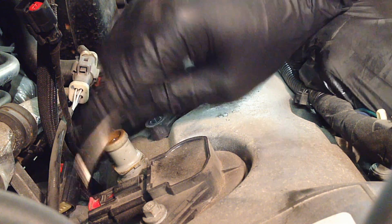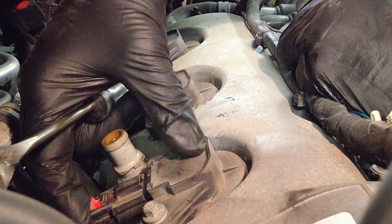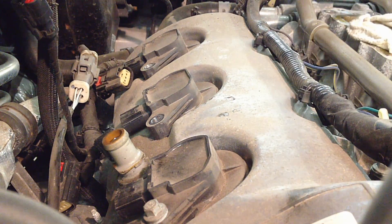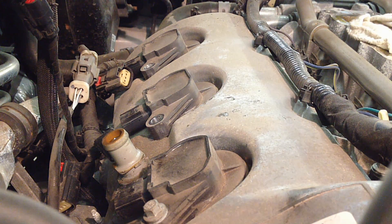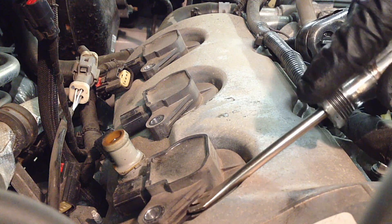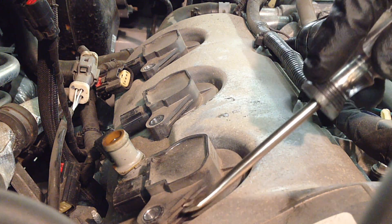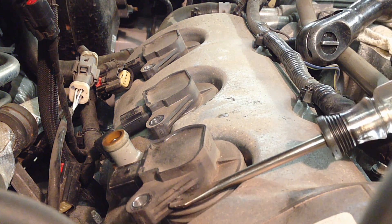There's a little red clip — push it down. Then you can push in on the connector towards the coil, push down the little black tab, and you'll be able to release it and get it out of the way. Pull this 8 millimeter bolt off to the side so we don't lose it down in here. Then use a cat claw or something like that to get in these ribs right here — you can get in the bottom one and pry up on it.